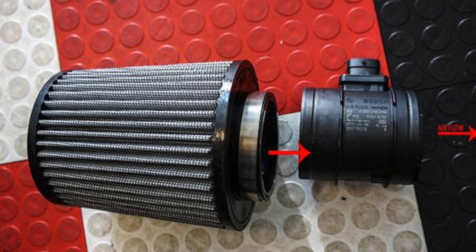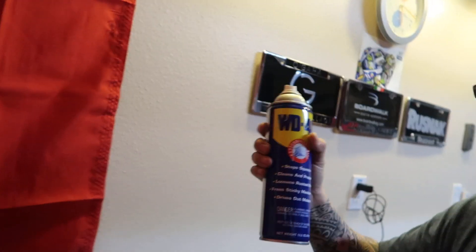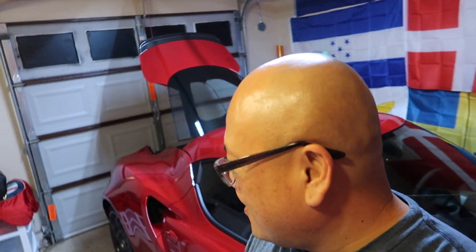You're really not going to mess anything up unless you mess with the MAF sensor. The way you attach the MAF sensor to the filter unit itself can be pretty touch and go. Here's the best tip: just put a couple of drops of dishwashing detergent in water, put a nice layer on there so it lubricates and it slides on. Do not use WD-40 — you'll just mess it up. Just do the water thing and you'll be fine.